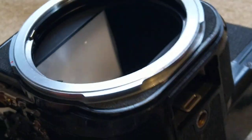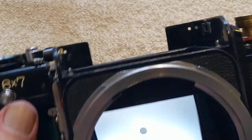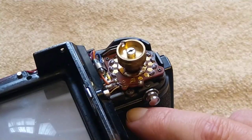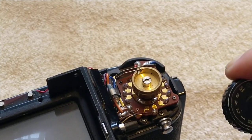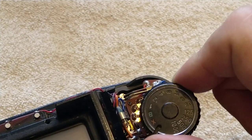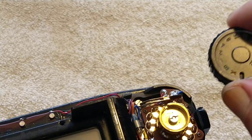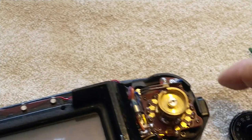That looks fine. Put the battery back in. You can set a faster shutter speed — I found the issue was happening mainly on the 60th; that seemed to be the problem speed for me. So wherever the 60th is, this just follows around in order. This first one here would correspond with X, which is the flash sync speed — the 30th by the way. And then it follows around: B, 1, 2, 3, all the way around. So 1000 is going to be at this end and the X speed is this one.